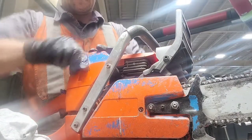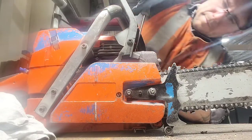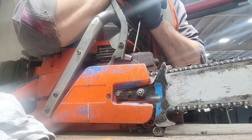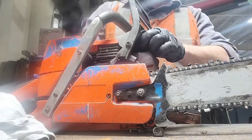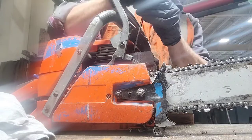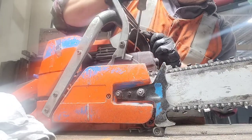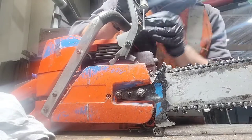Lean saws will eventually overheat and cause costly damage like a scorched piston — the cost to repair such damage is often not much less than the price tag of a new saw. Now I'm going to remove and inspect the spark arrester, which is essentially just a metal screen that prevents sparks from spitting out of the muffler. It's a safety feature for preventing forest fires. Sometimes they get gummed up with carbon, often because of too much oil in the saw gas.